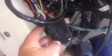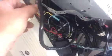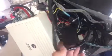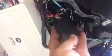Actually, before I show you that, here's my ASWC-1 access box right here. Now this thing is like $42 on eBay shipped. I'm not selling it with the radio because it's just not worth it for me, because I'm going to end up charging you like 60 bucks for it because I want to make some money on it. So you might as well just buy it on eBay, because I really can't install it for you. It's 4 wires, and there's really nothing that gets wired into the radio. It's getting wired into your harness. You're going to just put 12 volt switched with your other radio, 12 volt switched, your ground, and then there's a signal cable on a harness on the side. Again, I'll give you a link to a video on it, and it's just 4 wires, and it comes with the instructions to program it.